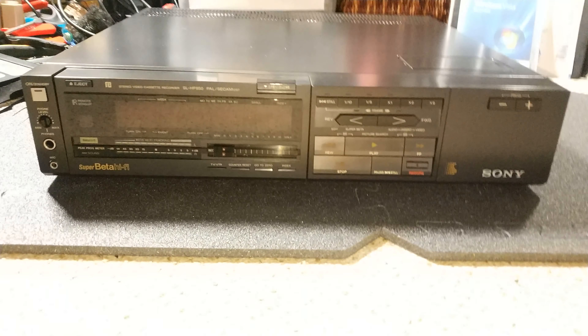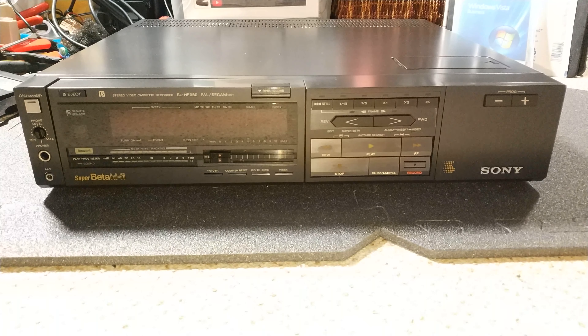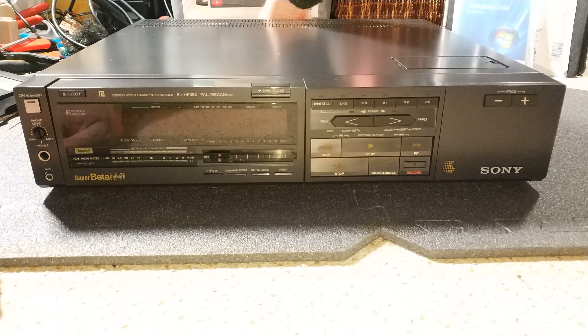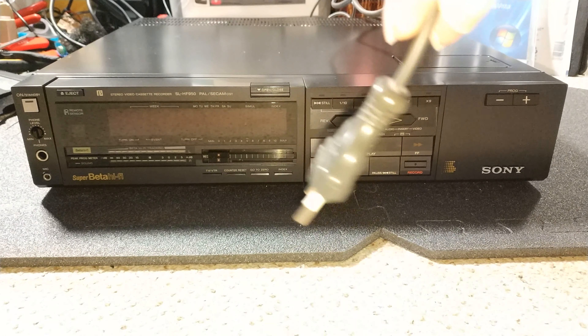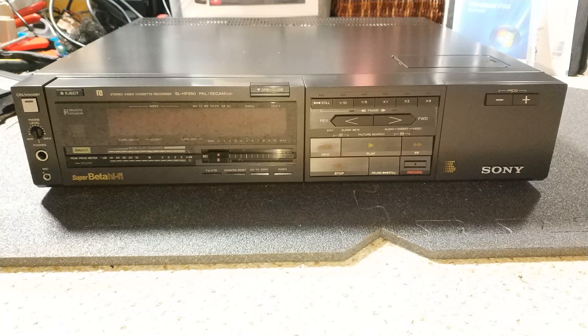So this machine is playing dead. I will do the standard checks — we won't be looking at the mains plug because it's a Euro plug, so no fuse actually in the plug, but we'll check the fuse at the front end there. I am 99.9% sure that it's going to be the power supply — it's going to be those two transistors in the primary side, and one of those caps, if not both of them, will be bad as well. So, without further ado, let's crack on.